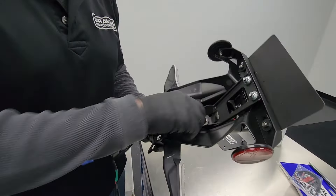Now I'm going to do this license plate light. I like to have the license plate light installed on here. You get two of these — you can activate these with a hair dryer or just a heat gun. These shrink down over the wires, and then you have a wire go through either side of the center piece of solder. When you heat it up, the solder melts and this shrink wraps over it — and you're set.